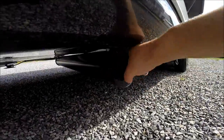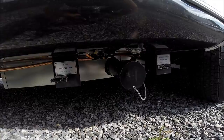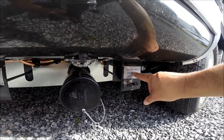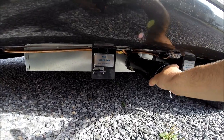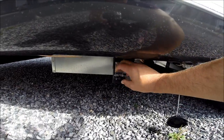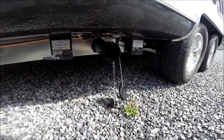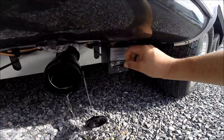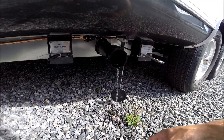You have a waste hose storage tube. There are waste gates for our black tank, which is the main tank, and our gray tank, which is called the auxiliary wash. There's a light outside to illuminate this area at night. When you take the cap off, you snap on your waste hose, empty the black tank — solids will come through which will contaminate your waste hose. After that's done draining, you open your gray tank, which is your sink and shower waste, and it will wash out your waste hose.